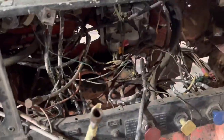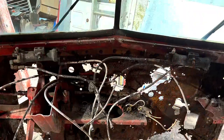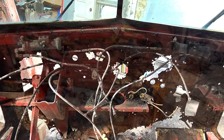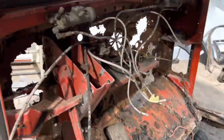Throw your nasty old wiring loom away — or put it away nicely if it's a good loom you're going to reuse. Then once you disconnect the last of the airlines for the parking brakes, I literally just ripped the manifold off the firewall because, as you can see, mine's made of paper.